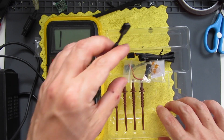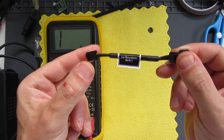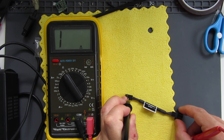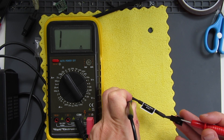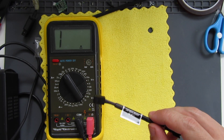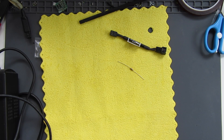Then I had a look through all the extra bits that came with it and found this NA-RC11 low noise adapter. It goes in line with the regular cable and reduces the amount of noise. I figured it's probably just a resistor in there, so I took my multimeter and checked all the different points. It turns out that on the middle point - the red wire - it comes up as 100 ohms of resistance. On the other two there is negligible resistance - just wires going straight through - but 100 ohms on the middle.